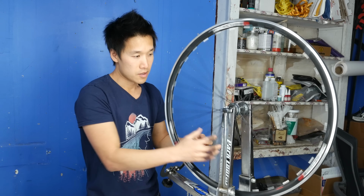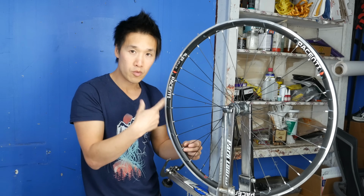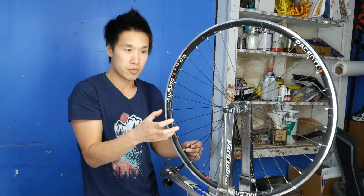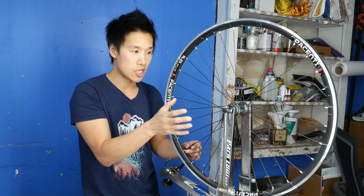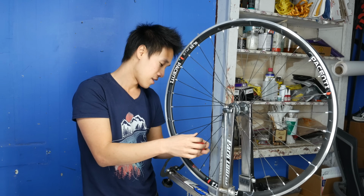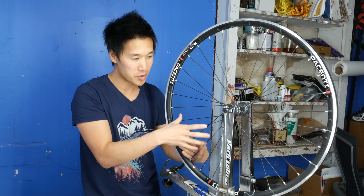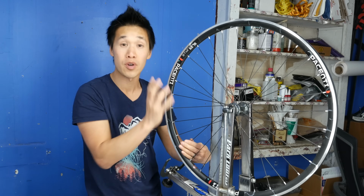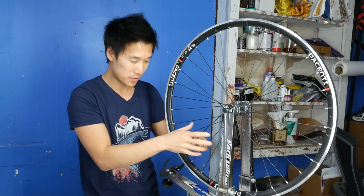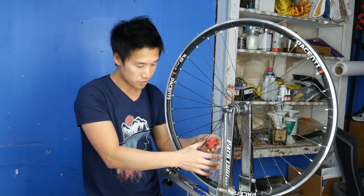Okay. Now it's not unusual that when you tighten something and you spin the wheel again, you hear another spot somewhere else. That's very, very normal. What's happening is since you're creating tension in the wheel, that tension has to move somewhere, and oftentimes you're chasing your own tail, where you tighten one spoke, something else tightens, and something else shifts. That's very normal in wheel building. Don't get frustrated. Don't get annoyed. That's very normal. So again, right here, I'm going to tighten by 1/4 of a turn.